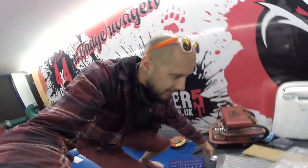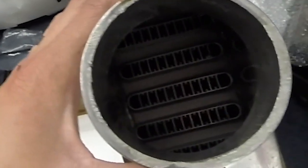I'll show you the reason why I think that is. If we look in here, you can see there aren't many fins on the inside of those tubes. More fins means more surface area for the air to pass through. With a lack of fins, it basically won't heat-soak the intercooler properly. The air passing through cools it - that's how it exchanges the heat. It heats up the fins on the inside of the intercooler as air passes through, and then the air coming through the front of the vehicle cools the intercooler, cooling the charged air going through. As you can see, there aren't many fins in there, which means not much of that exchange could take place.